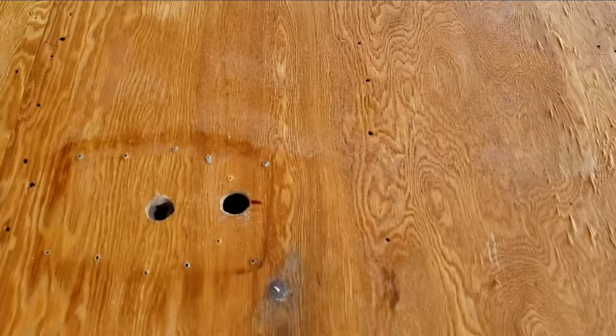I'll take a look at this edge — you can see where this was definitely getting some water damage, but it's still nice and strong. Just some water staining at this point, so we got it just in time. We eased the edge with the grinder so that it's not tearing the edge so much, and then of course the high-tech edging right there. So we're just going to be rolling this thing out here shortly and it'll be done. There's a new roof membrane down. We didn't have to overlay this because that deck was in great shape, and I think this is laid down pretty well. We'll let that cure overnight and get everything put back on tomorrow. Before this roof, it ended right there on both sides — that's how short that material was. I think they really did pull that pretty tight in order to get it over the edge. We eased that edge so it shouldn't have a sharp edge anymore.